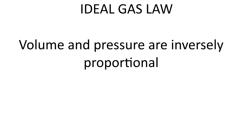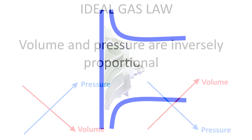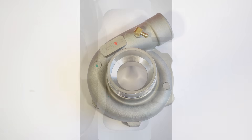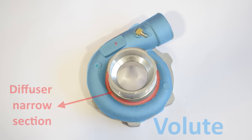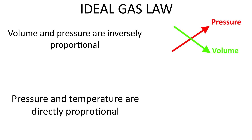To understand how the diffuser does this, we look at the ideal gas law. The only thing you need to know from the ideal gas law is that gas pressure and volume are inversely proportional — as volume decreases, pressure increases, and vice versa. The shape of the diffuser incorporates a dramatic decrease in volume. The compressor wheel flings and stuffs the air into the narrow space, which slows it down and pressurizes it. The air then travels through the volute and into the engine.